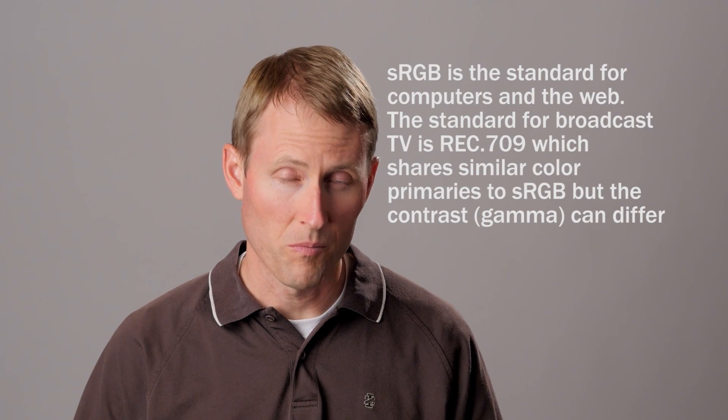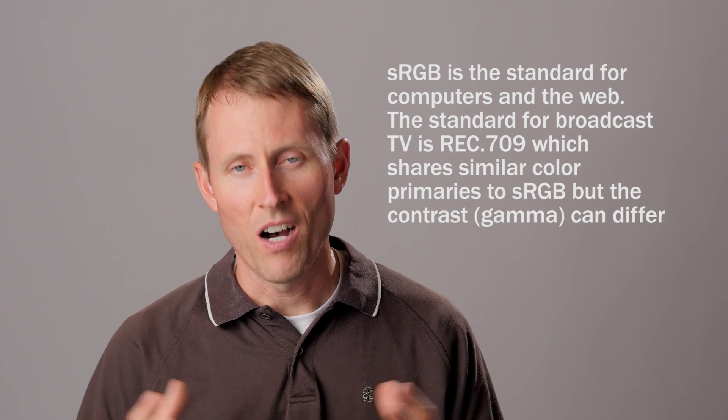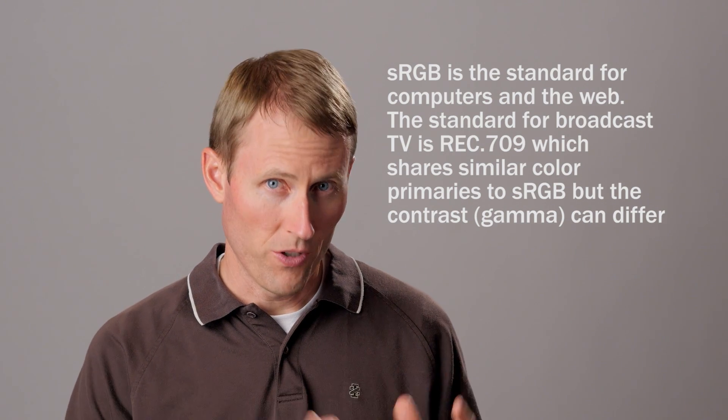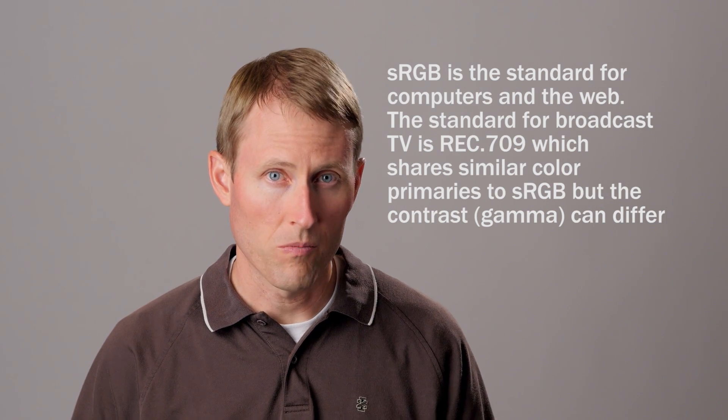What calibration is typically doing is making it so that the colors your monitor represents fall within a specific color space, and that the contrast and brightness are also representative of the standard. Get the colors right, get the contrast right, get the brightness set right — and between those three things it sets your monitor up to adhere to whatever standard we're aiming for. For computers — Windows and Mac — we're talking about sRGB. That's the standard the web is really built around, and the majority of viewers are still watching from their computers, even in September 2014.